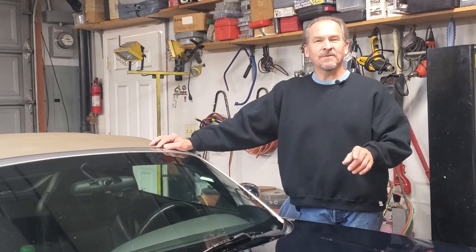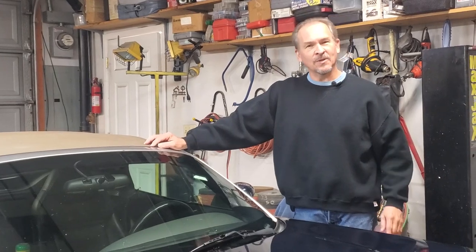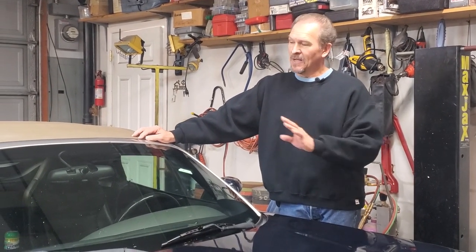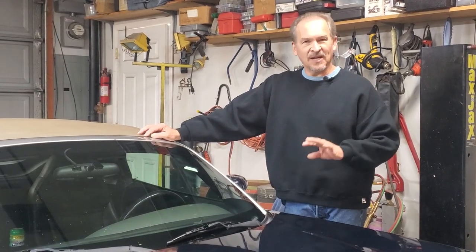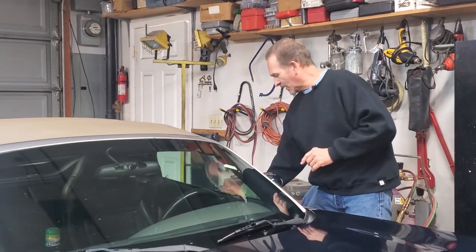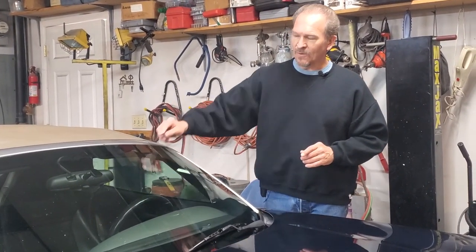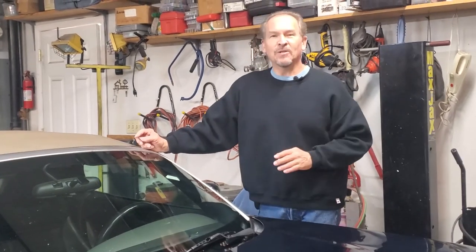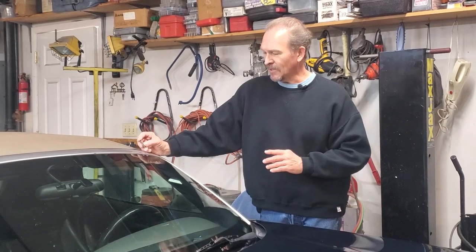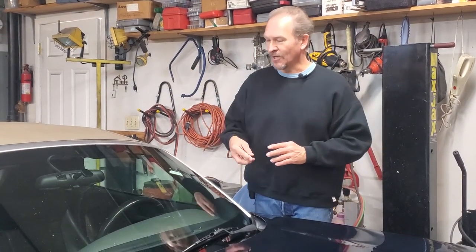The first thing you have to do is clean your window. For the initial cleaning, we just washed it off with a little bit of dish soap, vinegar, and mostly water, then dried it off. But that's certainly not clean enough. The next step was to grab a single-edge razor blade — brand new — and scrape the entire windshield, because there's going to be a build-up of material on there. This is an easy way to do it at home and get it clean. We went over the entire windshield using a scraping motion.